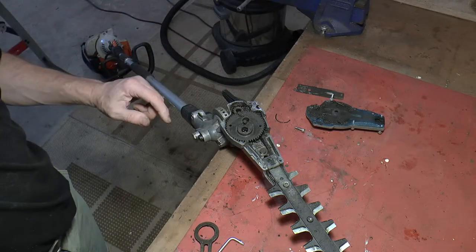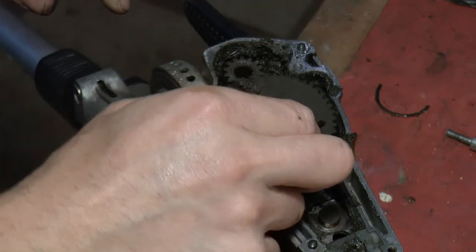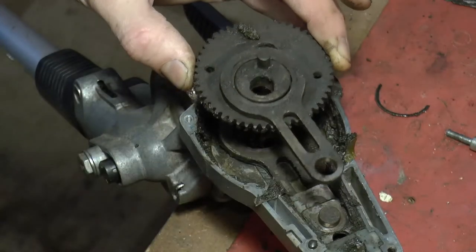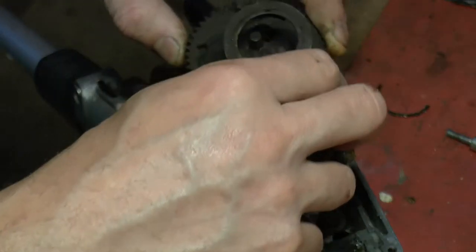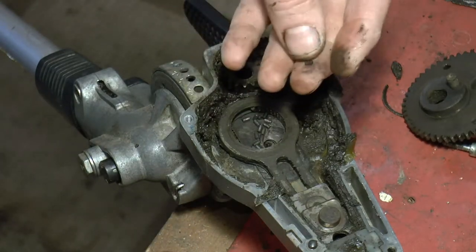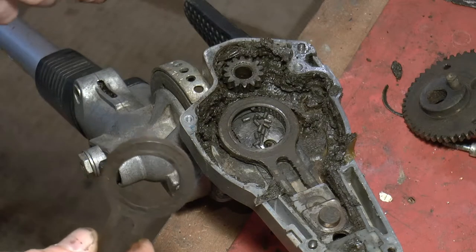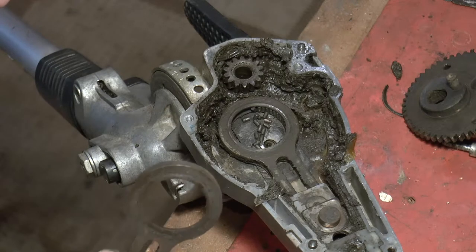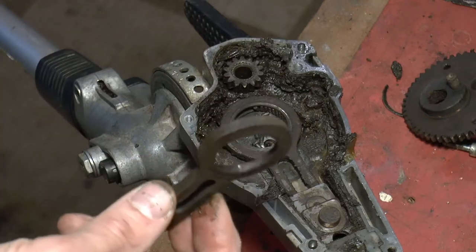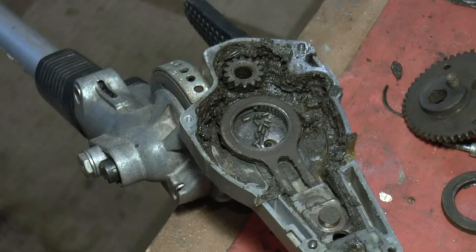There are oscillatory parts - I think they're called push rods. The drive comes up here and rotates a bigger gear wheel, and on it there are two offset cams that push these push rods back and forth, making the blades oscillate - one at the top, one at the bottom. When I took that out I found more bits of metal, and these little things like mouse droppings are actually the roller bearings - they've totally disintegrated.